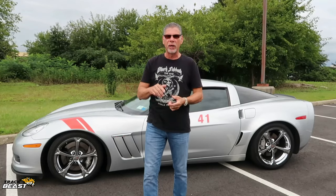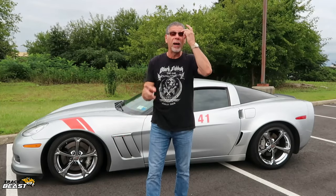It's a really, really nice setup. It's a radial mount caliper, which means it loads from the top and they give you brackets to bolt to the spindle and then the 2 bolts come up and then you just bolt the caliper on. Really nice setup. Very easy to take on and off. And I actually bought steel braided lines for it at the same time.